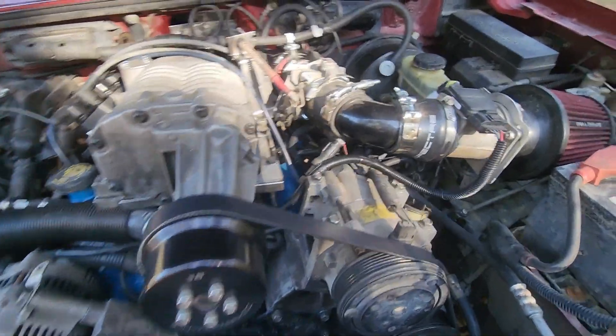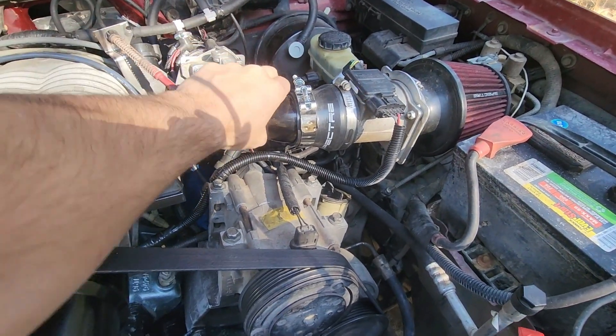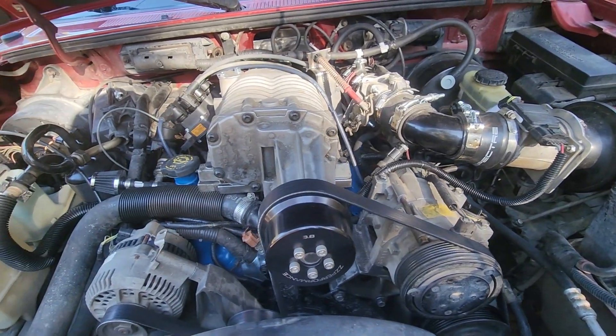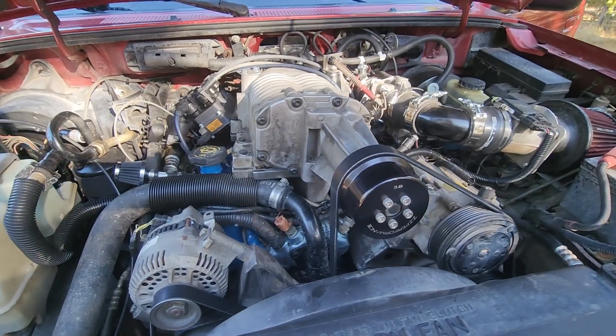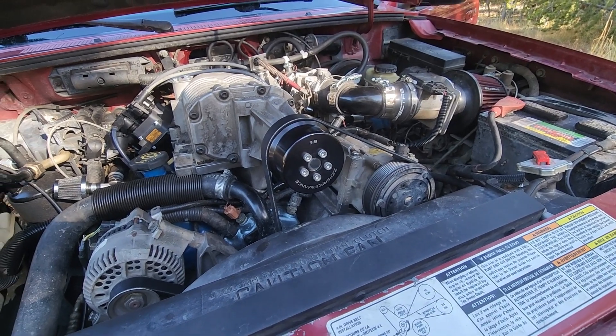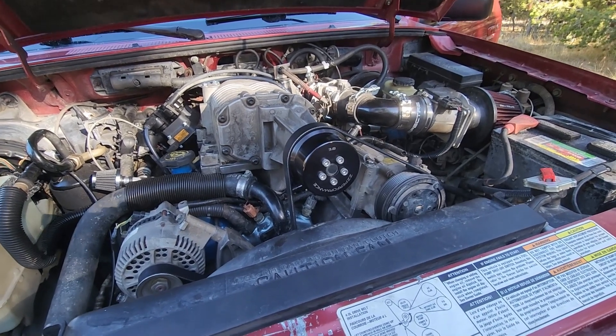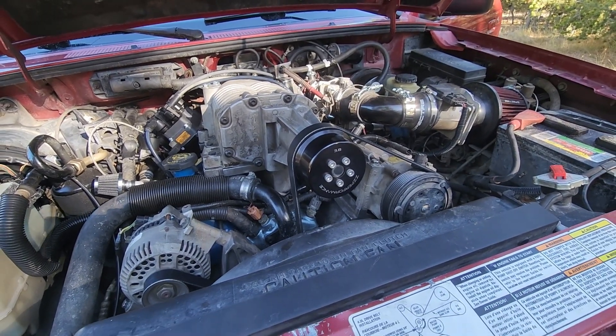We've got just about everything hooked up. The last belt was too tight and this one's actually a little too loose, but I think it might have enough to try starting it. I was in a mad scramble last night so I didn't get a lot of filming done. The supercharger's on and I've got a makeshift throttle bracket thrown together for air intake. I don't notice any vacuum leaks and it seems to be running fairly well, but the issue I'm having is I'm not getting any boost. I'm wondering if the larger pulley means it's just not producing any — it's running about the same as without the supercharger, which is frustrating.